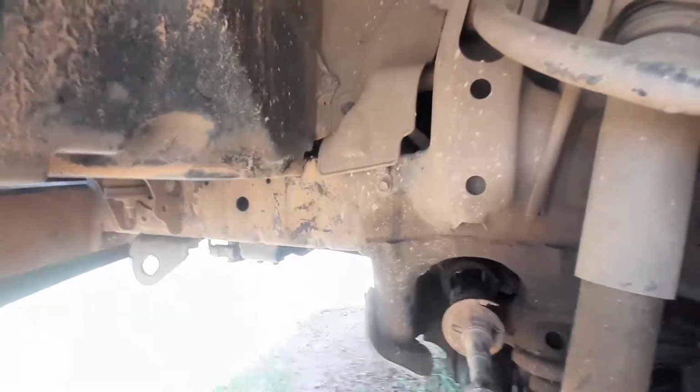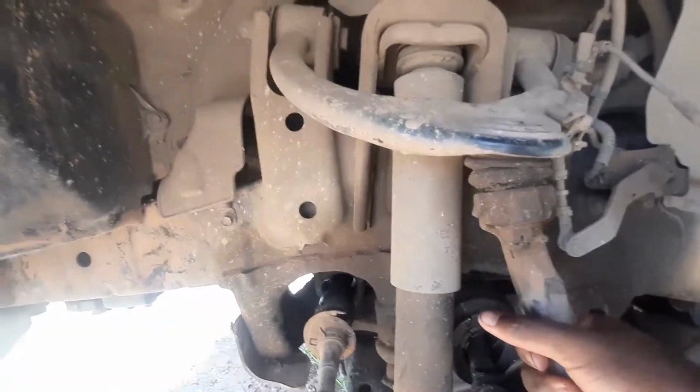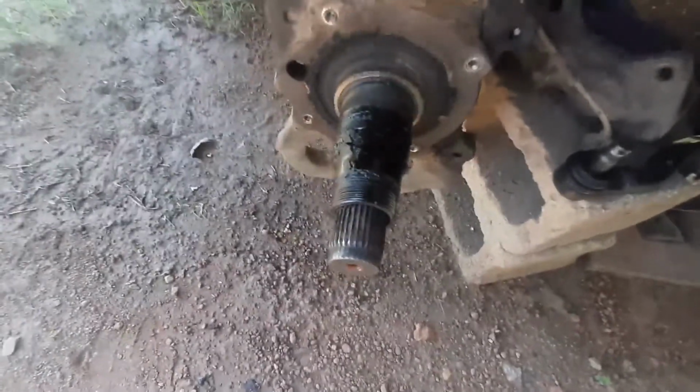Oh damn, oh damn, oh damn. And we can just pull the spindle down and out, and it should come right off. So let's get to that. And we'll also take off the boot. We might have to take off this nut to take the boot off, this front shredded part, and also the one right at the back. So that will have to also be arranged. You can see the end of the CV axle is worn down smooth.